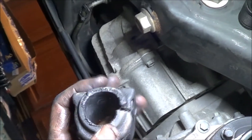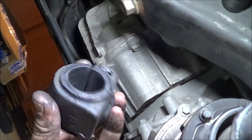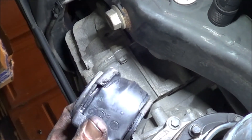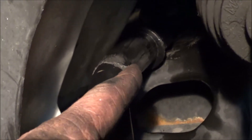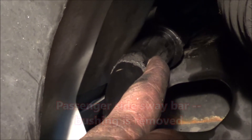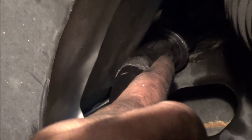Here's what the bushing looks like — this is the part that really concerned me. It's almost like the rubber liquefied and squeezed out. It's not torn, not dry rotted. I'm not sure if they had to be replaced or not, but with 150,000 miles on the car it's well worth it. The bushing definitely softened over time and began oozing out. I had a power steering pump leak and maybe that fluid caused this — both sides had it.